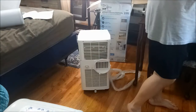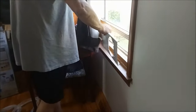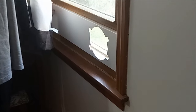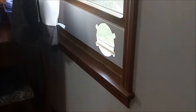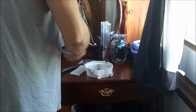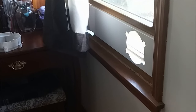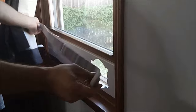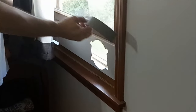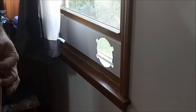You choose which side you want the air hose on, then flip it around. Close the window and the window holds it in place. It comes with foam to seal around it. See how there are small creases of light? You want to block those out. You cut the foam to fit — it's got pre-markings. It already has a spot cut for most regular-size windows. It's pretty much marked out, and for a larger window there's a spot to tear it at.